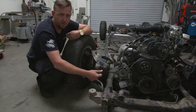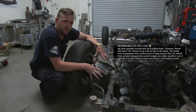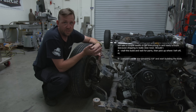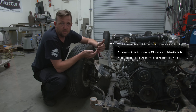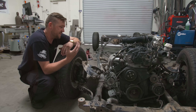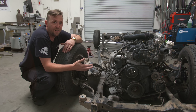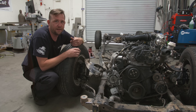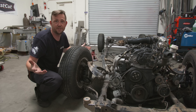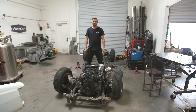If I cut that out of there, I get my quarter inch of drop. I posted it on social media for a vote. I have to rebuild this entire front suspension anyway, and it's going to take a while for those parts to get in. Should I stall the whole build and wait, or should I compensate for that quarter inch and drop the chassis on the deck and start building the body? Everybody said don't ever compromise — do it right the first time. But the timeline has nothing to do with it being right or wrong. I can still move on to the body, take that quarter inch out by cutting this pocket off, and nothing changes — the job still gets done right. So the plan is to take that quarter inch out, slam this thing on the deck, and start building the body so we don't lose any time.